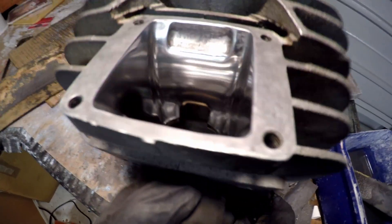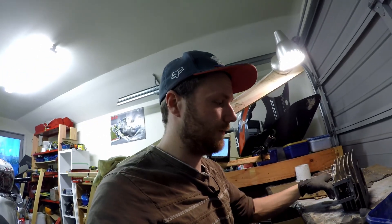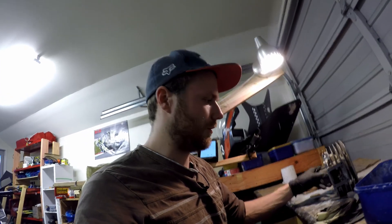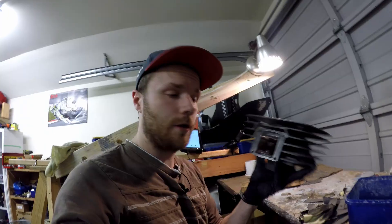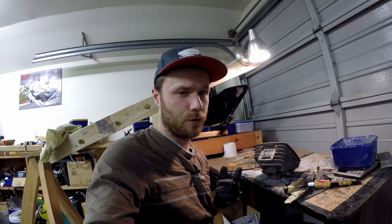Finished cleaning up, let's have a look at the finished result. That's our intake — completely mirror finish. I'll lift it up to the light and you can see it's super shiny. Porting and polishing is probably the most satisfying thing to do on a motorcycle — to see results like that is just beautiful. Quick comparison: that's our polished intake and the other side is the exhaust that's just ported and not yet polished. I'll do the exhaust off camera. If you want to see more porting and polishing videos, like and subscribe. This has been Logan from the Motorcycle Forge — I hope you enjoyed and I'll catch you next time.